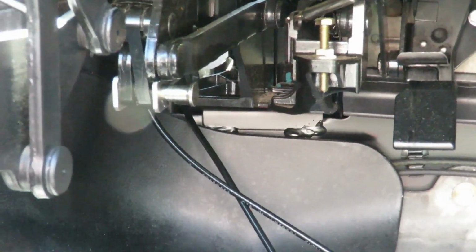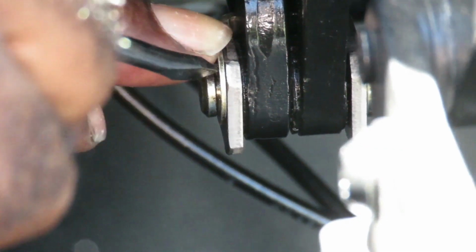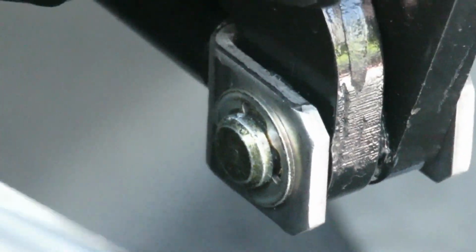Huh. Smaller screwdriver. Okay, push that pin through, and on the other side over here, let's get our E-clip up there, and what you gotta do is set the E-clip like that, get a small screwdriver, or a flat big screwdriver, and you gotta just pop that clip right into place, and that is done. Alright, we'll be right back.